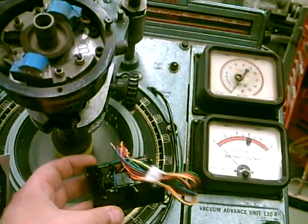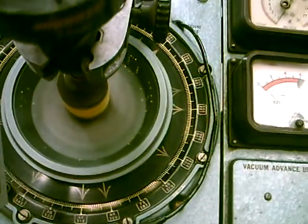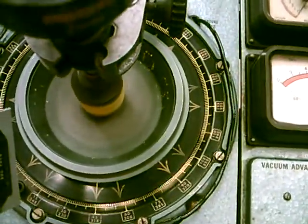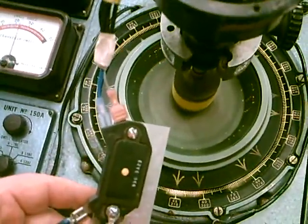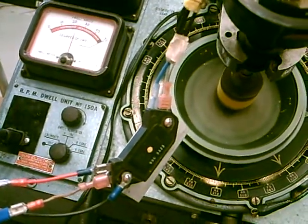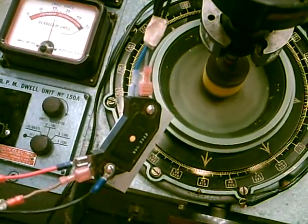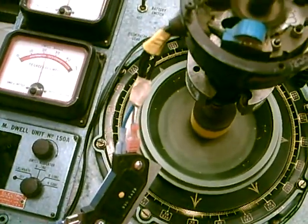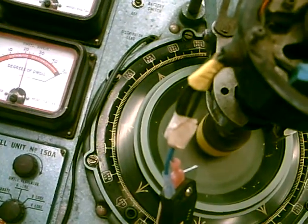The little electronics that does this just fits in this little module here. You take out everything in the back, put in 12 volts from a cheap LED power supply, and you're all set. It's a nice little unit now, and it'll attach to anything that's pretty much 12 volts. So that's the video for today — think about this: if you're at the point where your strobe neon tube is getting weak, these are nice and bright, and it's a cheap setup. You get to use 12-volt electronics without buying anything extra.